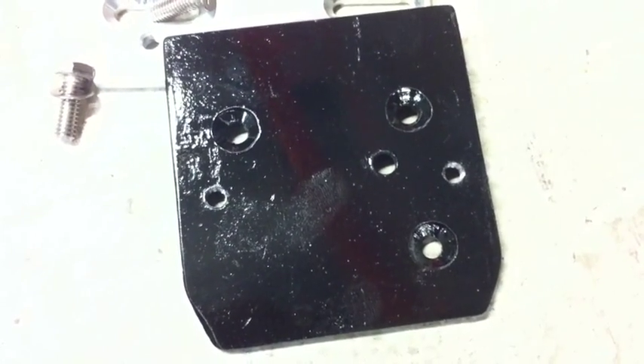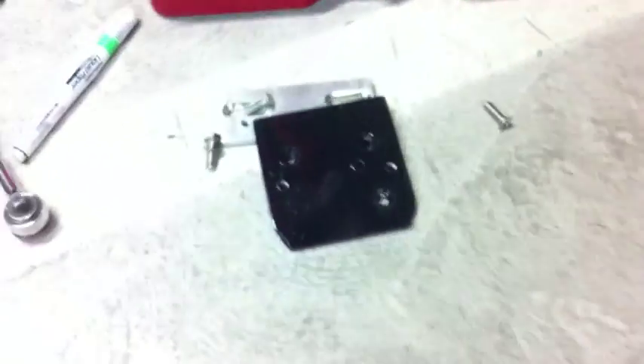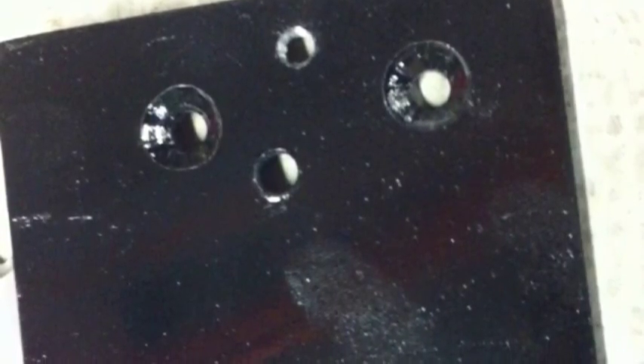This is the bracket I've fabricated for the job. I'll remount the horn and put it back there, pack this out a little bit so that bracket can go in, then bolt the MOSFET onto this. With this bracket, I had to pack it out from the bike's standard mounting points with some washers, about 6mm. I also drilled two holes and countersunk them so that the countersunk heads would fit underneath the rectifier. Because I was using 6mm steel, it was thick enough to countersink the heads and keep it nice and flat. There are also two holes at either end that were tapped with a 6mm thread to bolt the rectifier on.